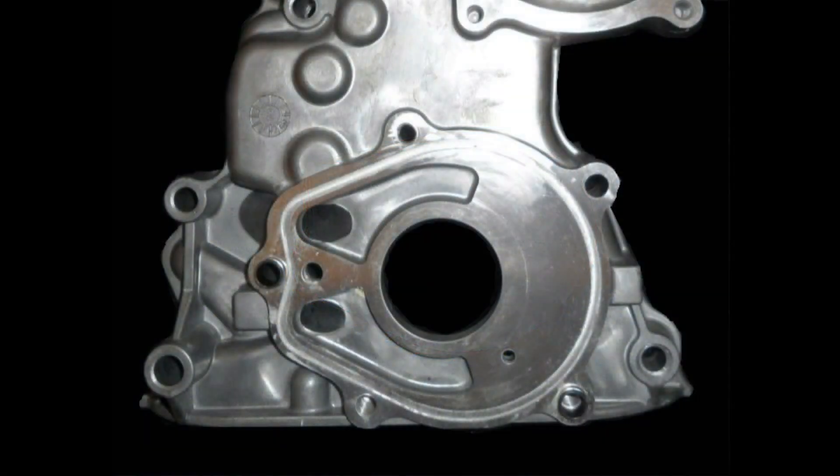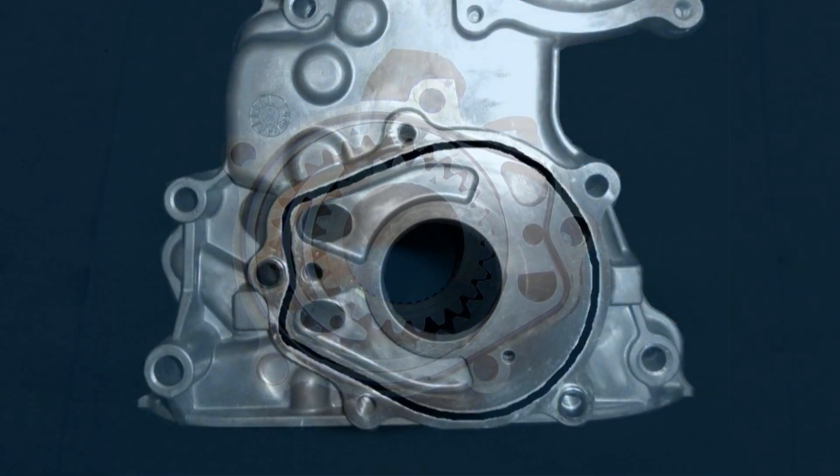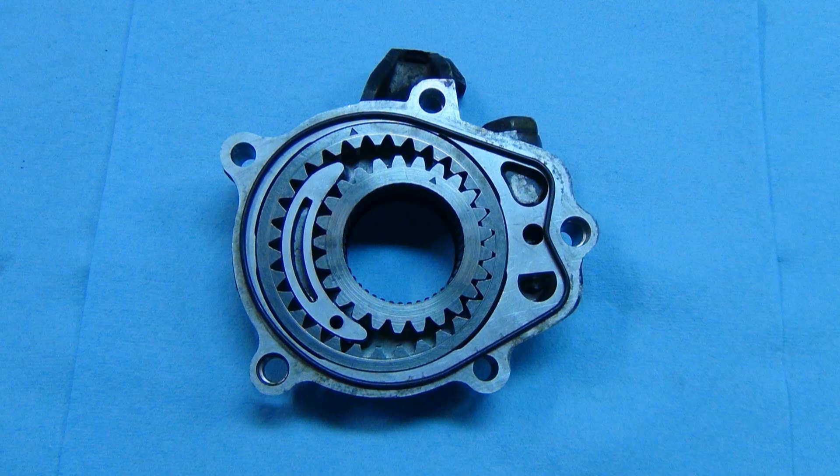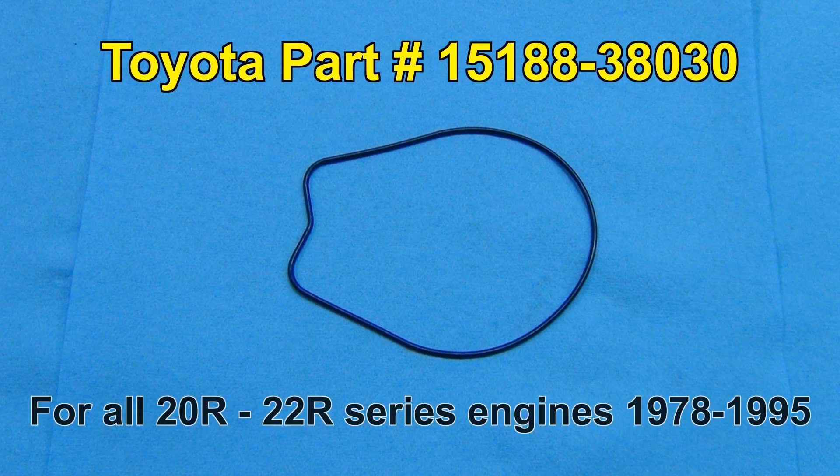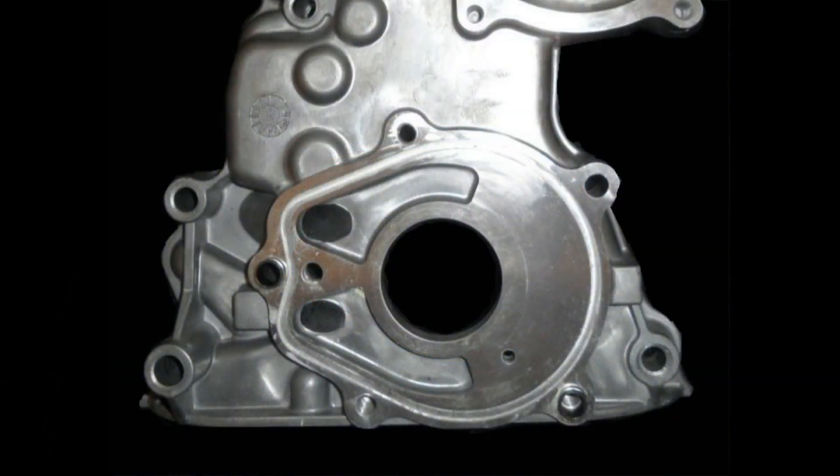There's a funky shaped o-ring that seals the oil pump body to the timing cover. The timing cover has a groove in it that this o-ring sits in, and the flat back of the oil pump housing presses against it to make the seal. It's a good idea to replace that o-ring if you're this far into the engine. The Toyota part number for the o-ring is 15188-38030, and it's the same part number for every Toyota 20 and 22R series engine from 1978 to 1995. When you go to install the o-ring, put some dabs of grease at different points around the o-ring groove in the timing cover, then set the o-ring into the groove. The grease will hold the o-ring in place while you fit the oil pump body back on. If the o-ring doesn't stay fully in the groove, it'll get pinched and result in an oil leak between the timing cover and the pump body.